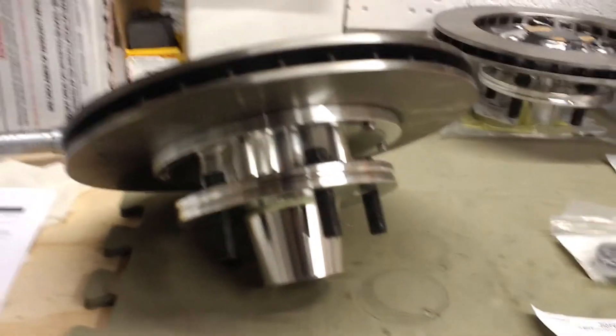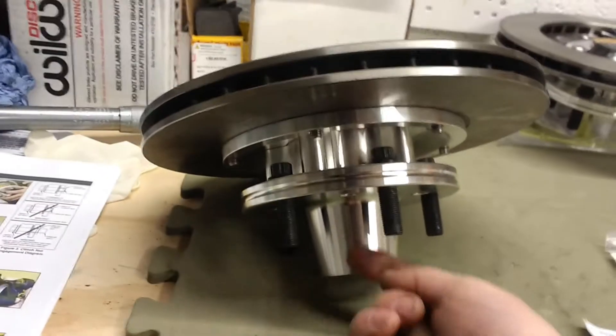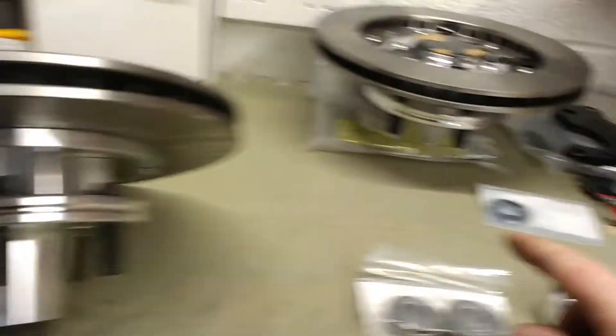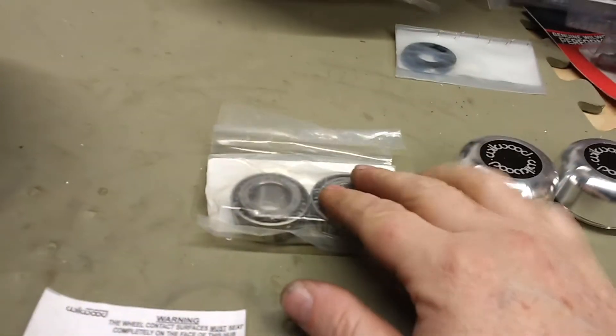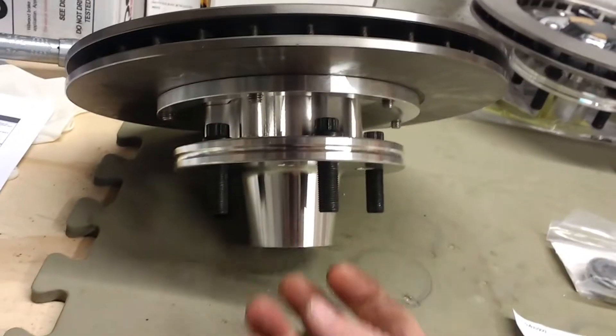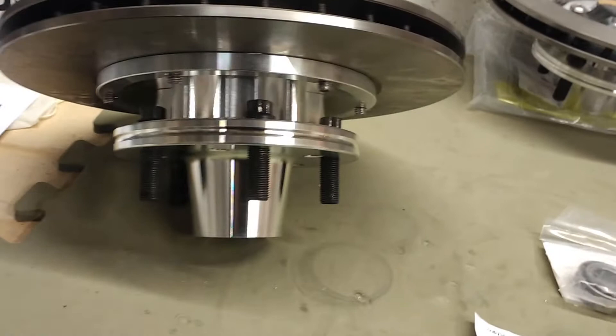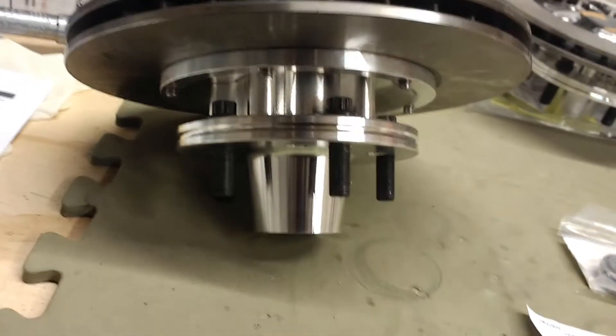This just keeps dirt out of my bearing — so this is the assembly. The next step is to slide this onto the spindle with a bit more grease inside, then manually grease the smaller outer bearings and push them in. Then add the washer, castle nut, and split pin. Check that the cap fits — if it doesn't, you can use slightly thinner washers.